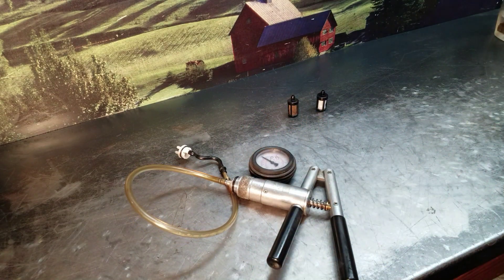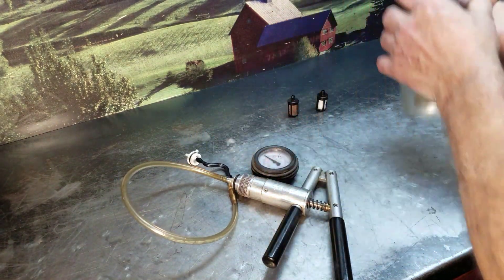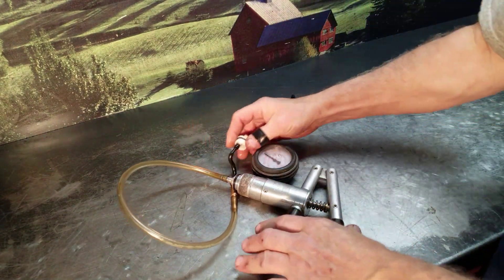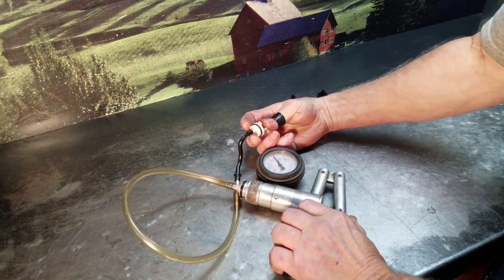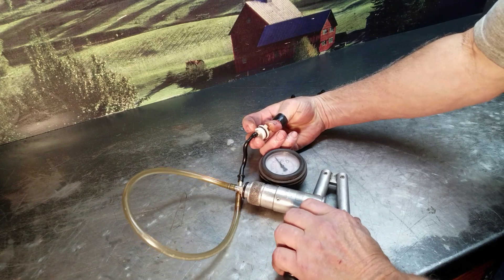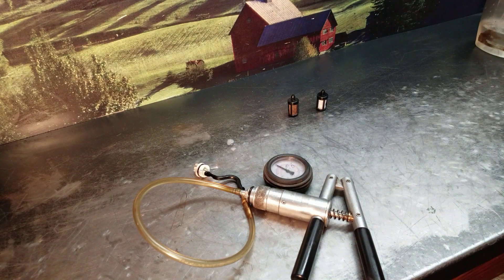It's not a hole in the fuel line. What it is, the fuel line has gotten a little soft on the nipple, and you're getting leakage right there. You can see some bubbles right there. A quick test would have shown that to the technician, but he missed it. Just be aware of stuff like that.